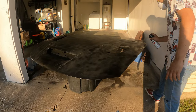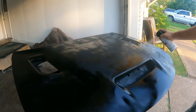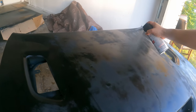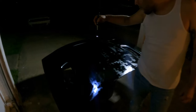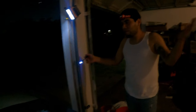We're just doing a couple of coats and then we'll show y'all what it looks like after — so this is the before. It got dark so we're trying to finish this though, so we're going to keep going. We did a couple coats on the hood. It looks pretty wet but it's actually dry. So we're just going to hit it with some 600 grit sandpaper. We had to go pick up some more black, and we're just going to try to get this thing looking as good as possible before we put on that clear coat.